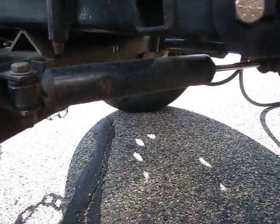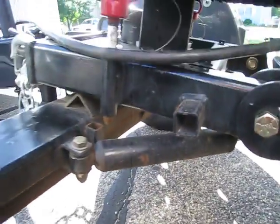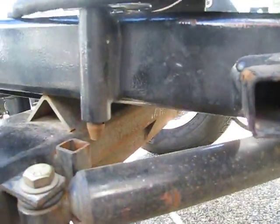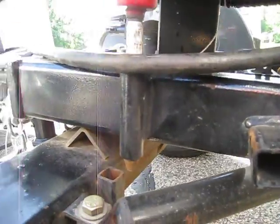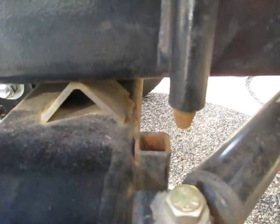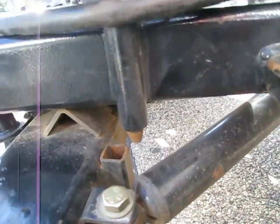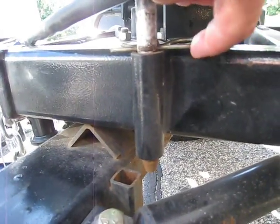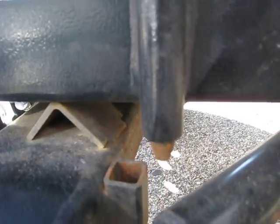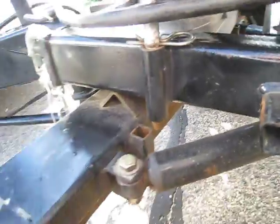There are some shocks to help stabilize the toad when it's going down the road, because it is self-sufficient pivoting, whatever you want to call it. It does have these lockout pins, which I have them locked out right now. As you can see, the holes do not align. When you're backing up, you pull these cotter keys right here, and it drops down into here when you're straight, which I'm not. And then you can back up — otherwise it's a single jackknife.